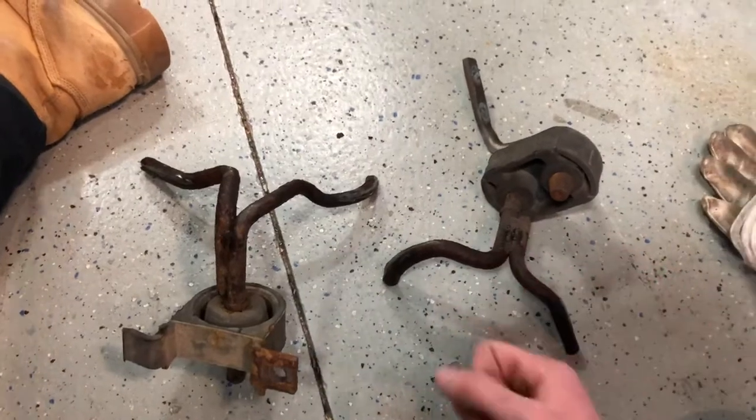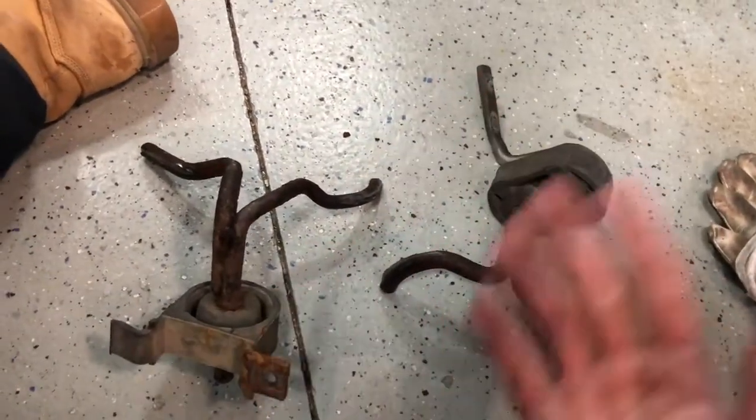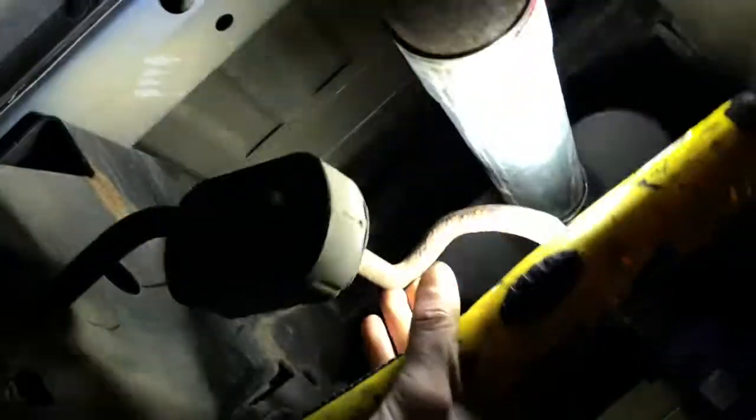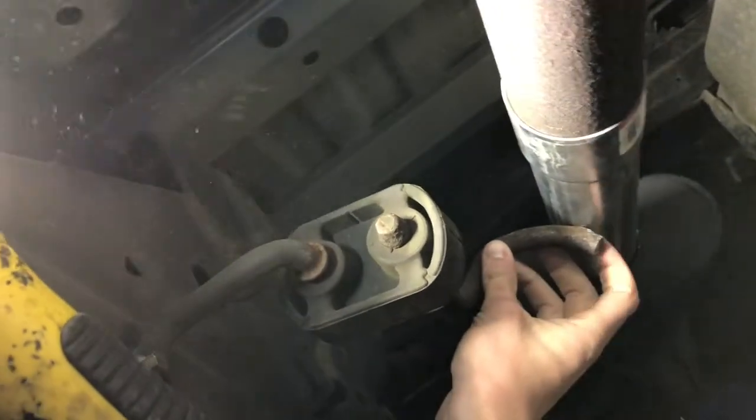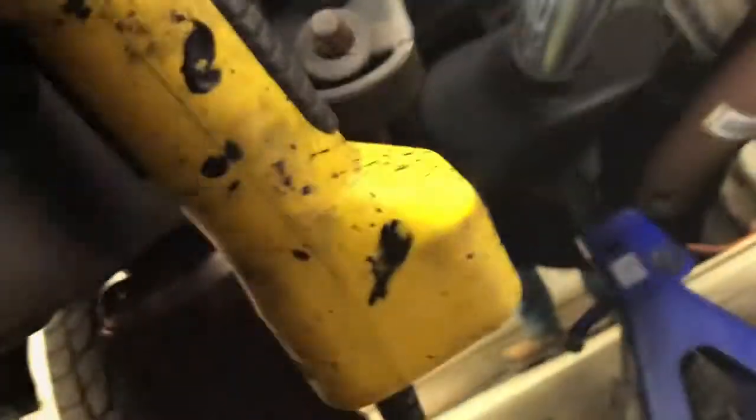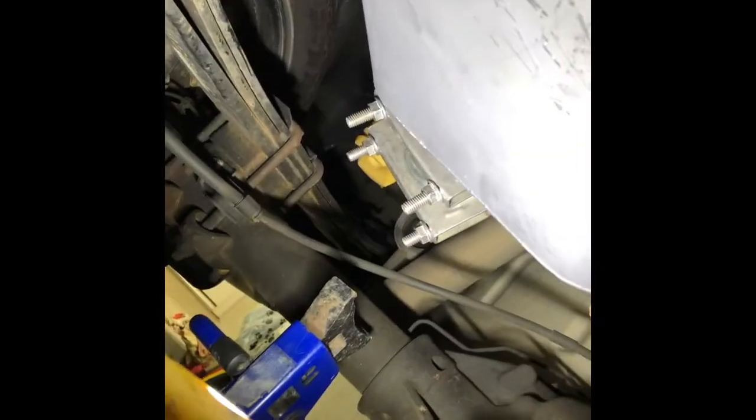If you need to bend the support beams into another shape, just use a mini sledgehammer and beat them for different angles or lengths. Now we're trying to fit them up on the new muffler. I'm going to shoot a weld on the bottom of the pipe to hold it up so it's not going to sag or bounce. We're going to put on the clamps with our gun and then weld the support beams to the bottom for extra support. The whole exhaust is done - we have the clamps on and the Flowmaster secured with more clamps in the back.